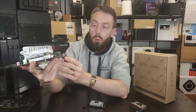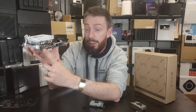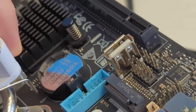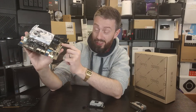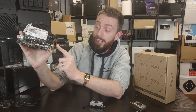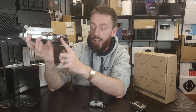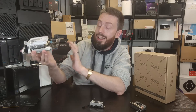Ports and connections on this motherboard are all fairly standard stuff for the most part. We've got plenty of USB ports - lots of 10 gig USBs and even a 20 gig USB Type-C port. At the base, we've got a couple of HDMI ports that support HDMI 2.1, and depending on the CPU you choose with integrated graphics, how far you can scope that really comes down to you. Although it is just 2.5 gigabit Ethernet - which opens doors to discussions about choosing between a PCIe upgrade card for storage potential versus NIC external connection.